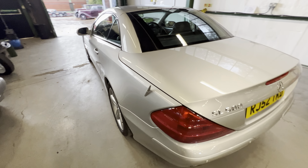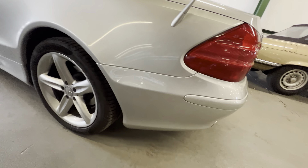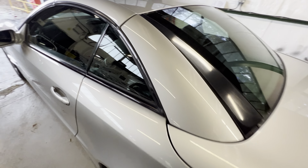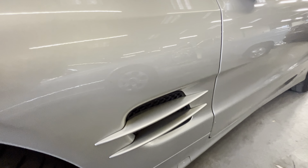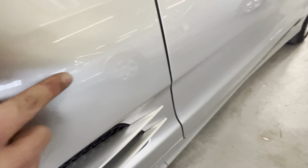The owner did tell me the sides have been painted, but whoever's done it has done a lovely job - the colour match is perfect, really really good. The bumper meets up all nice and even. Lovely solid arch there, another good wheel with a P Zero tire. We've got a couple of very faint scratches just down here - one which actually runs the full length of the door and down on the rear quarter, very very faint. It follows all the way up onto the front wing to the arch - like it's been driven a bit close to a hedge. It hasn't dented it, just a scrape across those three panels. It may polish out - you can't actually feel it when you run your finger over it, you can only just see it, but it is worth pointing out.